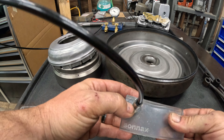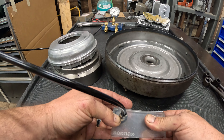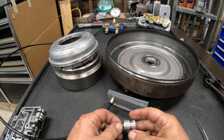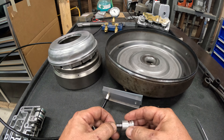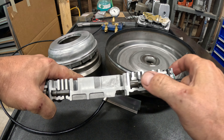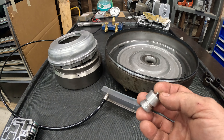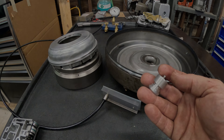Here's my little rig — you can see that gauge back there. It's about 11 inches of mercury. So that's no good. When these things are new they're more like 25 or even more. So 11 means we're getting a lot of leakage through the oiler hole and out around the plunger. That's going to apply less pressure to the piston, less force against the spring, and that allows the modulator valve to shift right — and then you're going to have all kinds of unexpected shifting experiences. So this will be trash. Anytime these don't pass vacuum — you've got to come up with your own acceptance criteria — but this was well below mine, so it would be replaced by a brand new one.